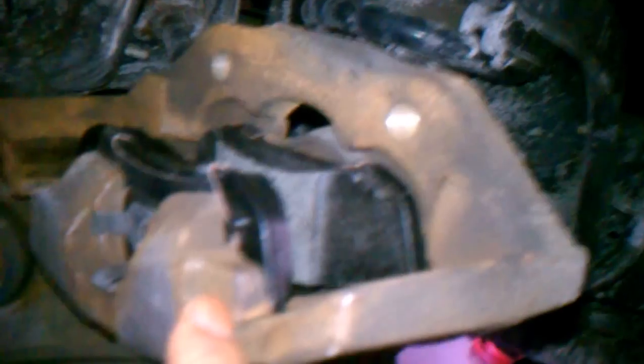in between the guide and the pad, like so, because this is one of the reasons why people think they have to cut the pad or shave it off, because it won't fit, because it's got to fit between this little guide and the bottom here of the pad. I don't know if you can see that. See that? It's got a slide under here, and this one goes here. So that's why people think, oh, well, you can't get it on because of those pins. Well, those pins got to come out. All right? We're going to walk over to the other side, and I'll show you what it looks like completed.